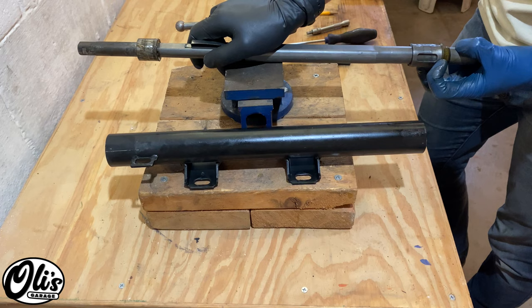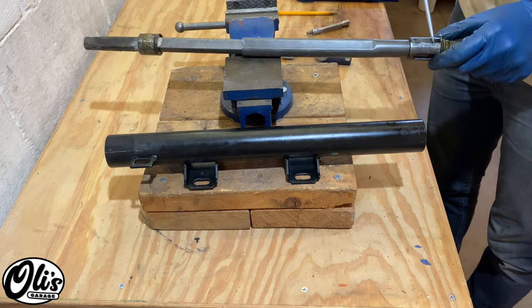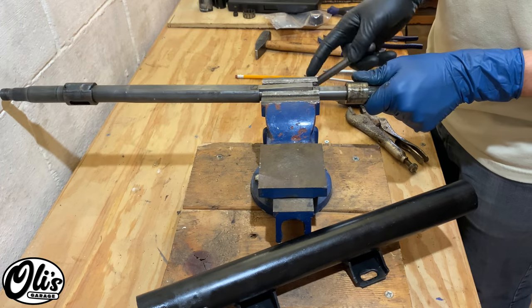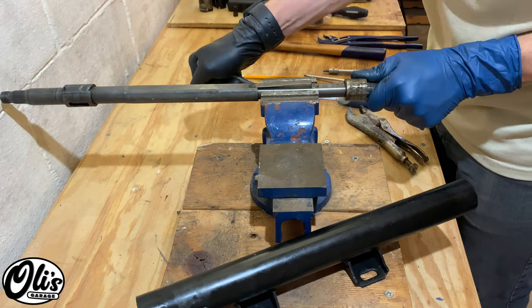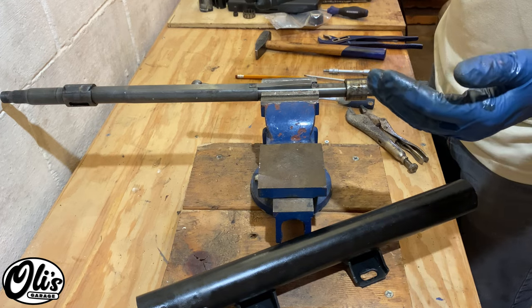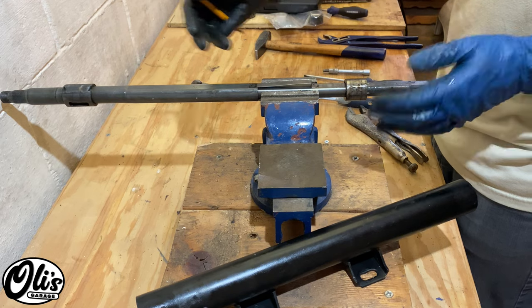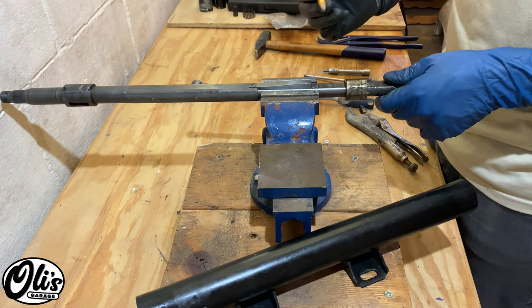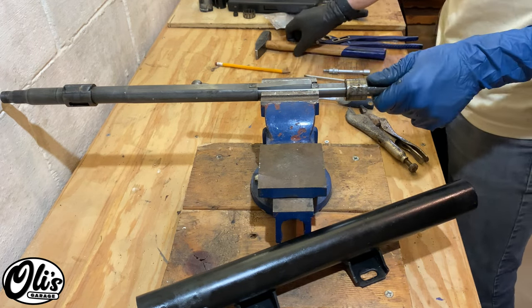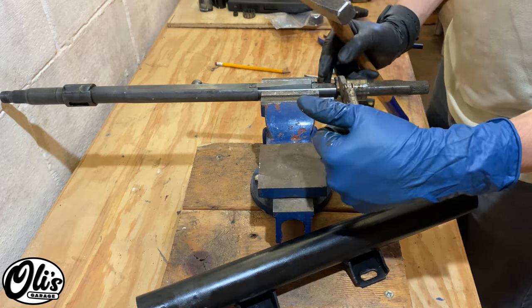Slide it off. Continuing disassembly, we can remove this race — just pry it off with a screwdriver. Grab your steering column and clamp it in a vise. The key is to clamp it on this portion right here — this little metal strip — because this is so that the steering column can collapse in the case of an accident if you smack your chest into the steering wheel. So we don't want to clamp it on this portion and change the length of our steering column. Next, grab a pencil and mark where this race is because we want to put the new race back on the exact same spot. Finally you can just take a hammer and drive it off — I'm using a vise grip to go around so it's driving on both sides.